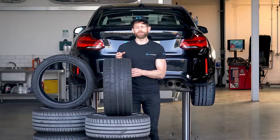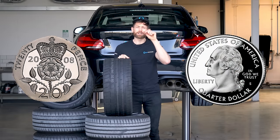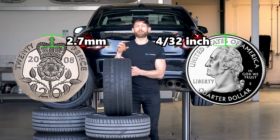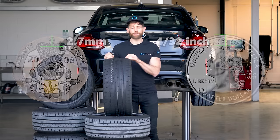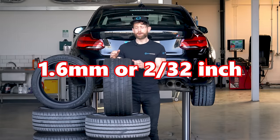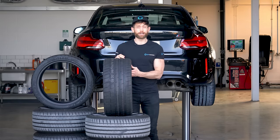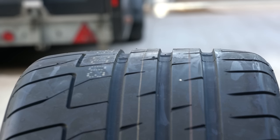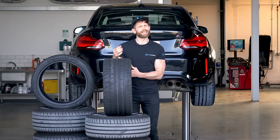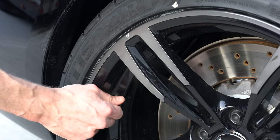If you can't find the grooves and haven't got a tread depth gauge, you can use a 20p coin. The rim around the outside of a 20p is 2.7mm, so that will show you when you get below the magic 3mm number. The legal requirement for tyre tread depth is 1.6mm across the centre 75% of the tread, but aquaplaning performance drops off rapidly after 3mm, so a lot of manufacturers recommend thinking about changing once they're below 3mm. Also check each wheel to make sure there's a valve cap on each valve — if there isn't, add it to your shopping list.